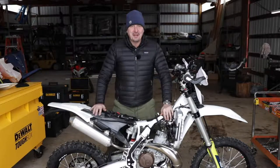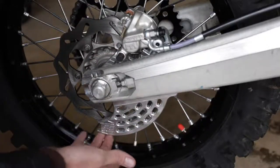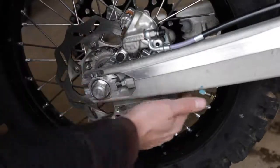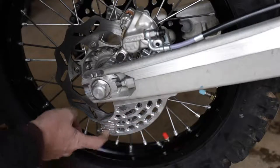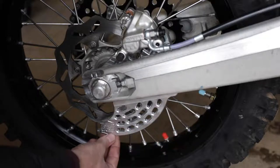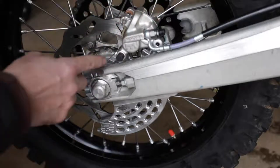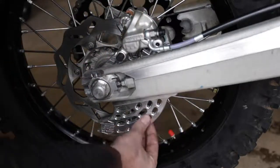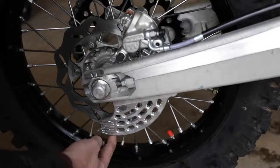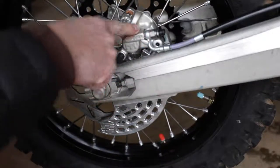Let's jump in. We'll go from tail to tip and I'll show you everything I've done. Starting on the right side rear: when you're riding rocks, you can smash and damage the rear discs really easily because they hang down so low. This is an Enduro Engineering shark fin — a heavy duty aluminum guard. This piece is replaceable and protects the rear brake caliper mounting.